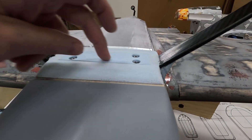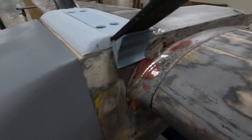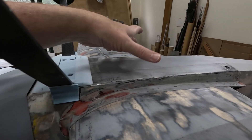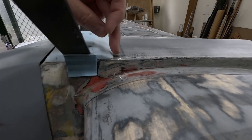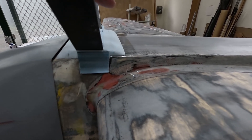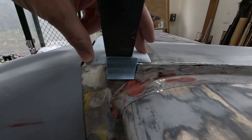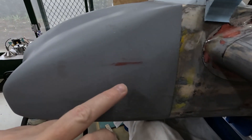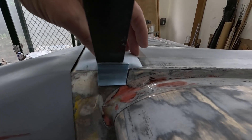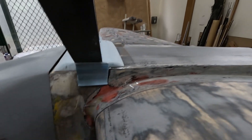My plan is to have it held in place with the same four bolts that hold the landing gear in place. One of the biggest problems I'm going to have is when this wing comes off, it raises up — which means this area right here raises up. It's not much, only maybe an eighth of an inch, but it might just be enough to cause a problem. I'm only going to use two layers of six-ounce cloth and a two-ounce layer — same as I did with the cowl — and that'll give me a little bit of flexibility.